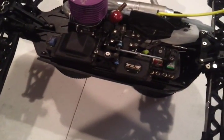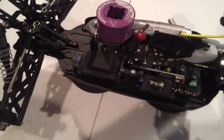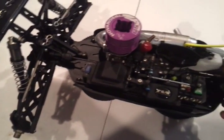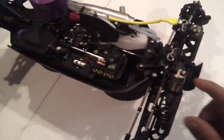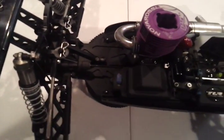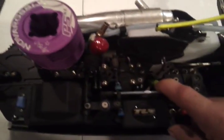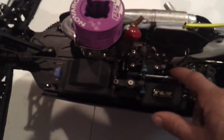If there's anything I missed or you'd like to hear, comment below. I can comment back and help you guys out. The lightened outdrives — I do have the HD diff cases in all three differentials. I have the lightened outdrives in the front, but the stock ones in the center and the rear. I do eventually want to switch them out; I just didn't have time — I wanted to get this thing going, and it's almost the end of the outdoor racing season. What you see here is just a little zip tie that I put to keep the wires held up so they don't run against the chassis. I've had servos ground on the chassis before, and trust me, a runaway is no fun.